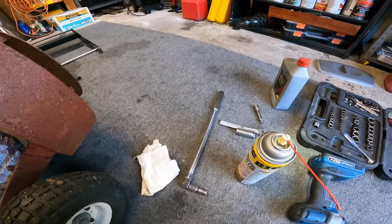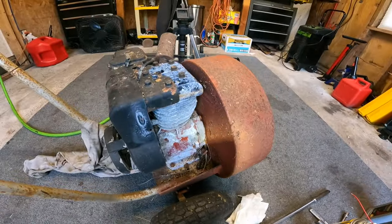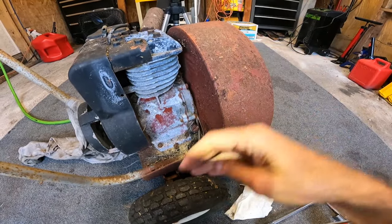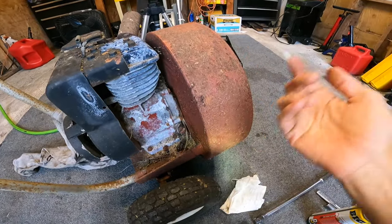The plug doesn't look terrible — it's definitely crudded up but there's no moisture. There is most definitely some yucky stuff going on, but let me get some oil down in here and we'll see if we can maybe get this thing free, because I can't even get it to budge. I've used up all of my Marvel Mystery Oil, but I've got some automatic transmission fluid here. We'll just pour a little bit down in. He said it was running when it was parked, so we'll see. I'm gonna look at the valves and see if I see anything moving.